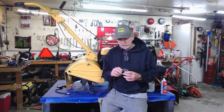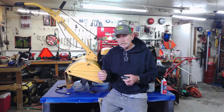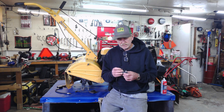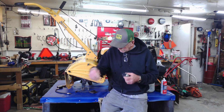On newer machines — like that Kohler on the Cub Cadet we did in yesterday's video — they don't have a ground wire connected. We were looking at it wondering where the ground wire was. What they've done is done away with the ground wire entirely. Now when you turn the key switch off, the electric fuel solenoid closes and that shuts off the engine. A lot of manufacturers are going this route, so on newer units the ground wire position doesn't matter since it's not used anymore. On older ones it does matter.